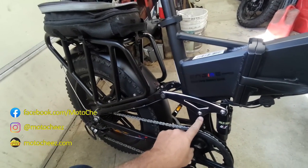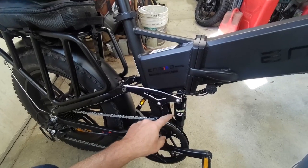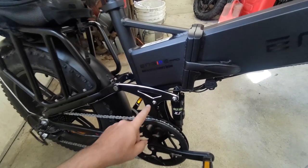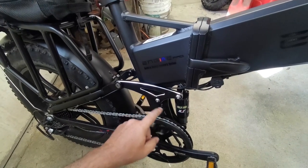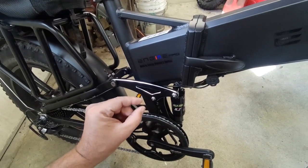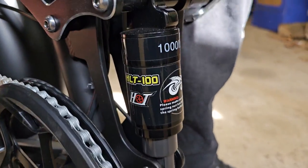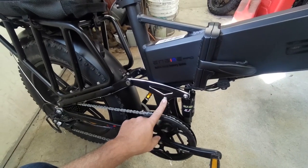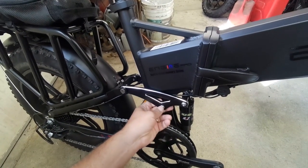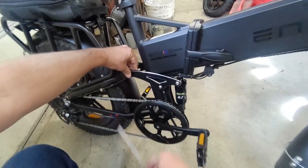I had a viewer Kevin tell me that there was another guy that did a video because this rear shock wasn't working like it should. I suspected that it wasn't because even having him jump up and down, the thing barely moved. So I loosened these up and sure enough that fixed it — it was tightening against the standoff that's behind there. I think I want to take this apart.